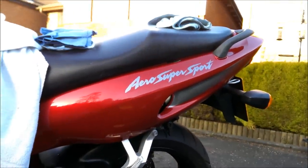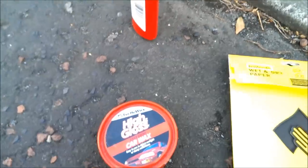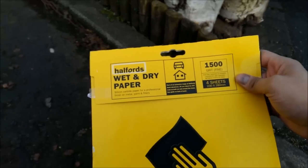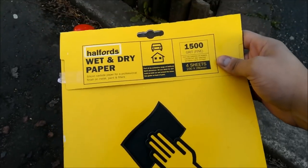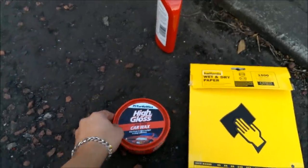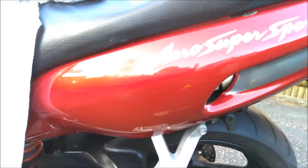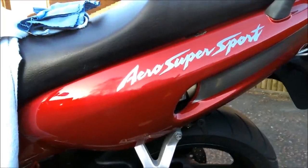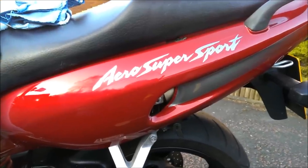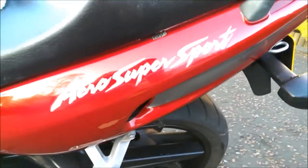I've never done that before so it's my first job at doing it. One of my mates Steve taught me about the trick. This is everything I use — so if you want to pick it up: Halfords wet and dry paper, 1500 grit. You can use finer ones like 2000 — it'll just take longer but it's a bit safer if you've got really thin paint. That's only $2.99. High gloss Turtle Wax and just some T-Cut, and obviously some cloths. I would definitely recommend it — you can't really do it if you've got a massive deep scratch, but if you've scuffed it against something like a pole, another car, or another bike and their paint has rubbed off on yours and it won't come out, that's a good option for you. Alright, I hope you enjoyed my little tutorial and don't forget to subscribe.